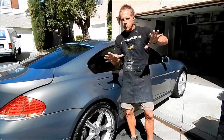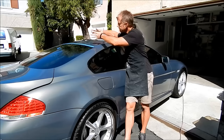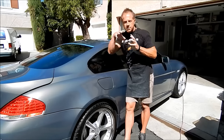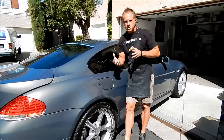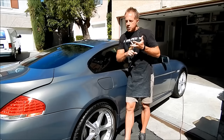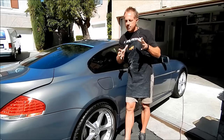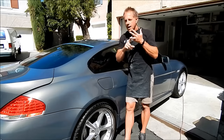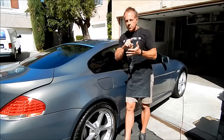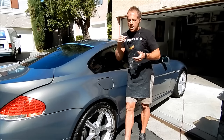What Bruce did not notice is that it looked like the previous owner had literally set a box on top of the roof panel and slid it off — there are some pretty substantial scratches. I told him I could do some wet sanding and remove a good share of those scratches. But this is where managing expectations comes in: they will not all be gone, but I can almost guarantee I can camouflage them by polishing to the point where you'd really have to look to see them.